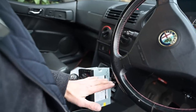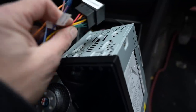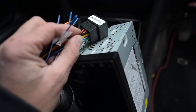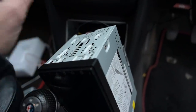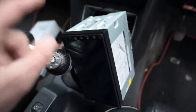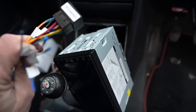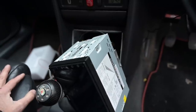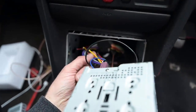The reason it's doing that, I figured, is because the new radio is able to wake up whether the car is turned on or off at any time. I had a look inside and probed with the test meter, and what I found is that there are two looms that come with this radio. The difference is the red and yellow power leads are switched and accessory. But Alfa Romeo in their infinite wisdom have left both the yellow and the red as permanent live.